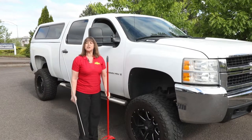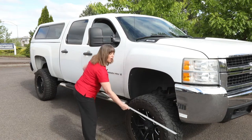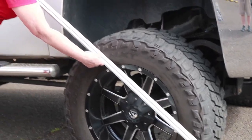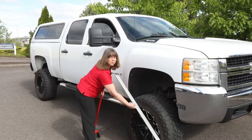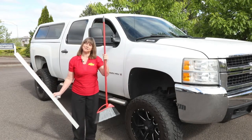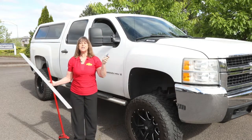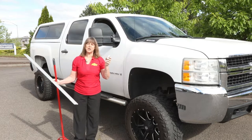To get these measurements you're going to need a straight edge that's going to reach all the way across the tires, and you're going to put that across the tires in line with the factory hole that you'll be measuring from. The best straight edge everybody has around is a broomstick. Just grab your broomstick, grab a measuring tape, grab some paper and pen, and you're ready to go.